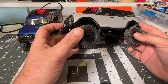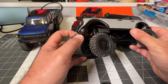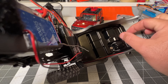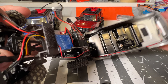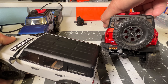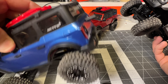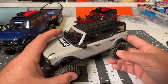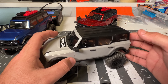For the comp truck we changed the wheels and tires - the class limits you to stock trucks so we did the Proline Hyrax, which the class allows. We're allowed to change the servo and we're running stock otherwise. The only other thing we did was remove the top: remove these two screws, it slides out, hooked on plastic in the back, four screws inside and the top comes right off. The rear tire has one screw - take that off to reduce weight.